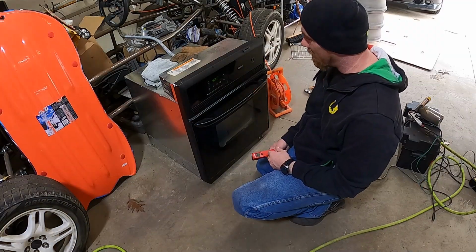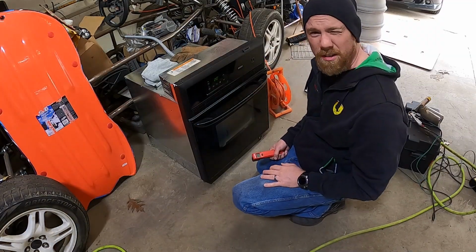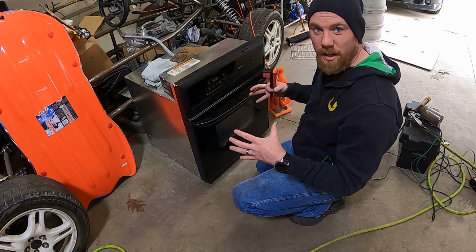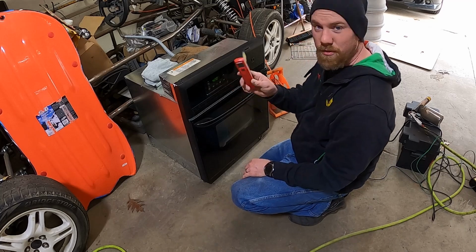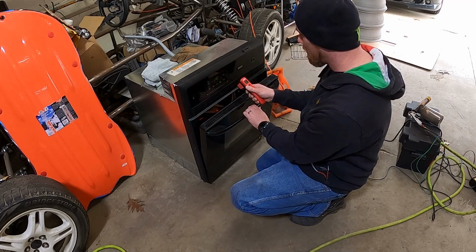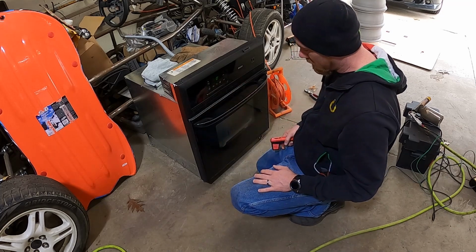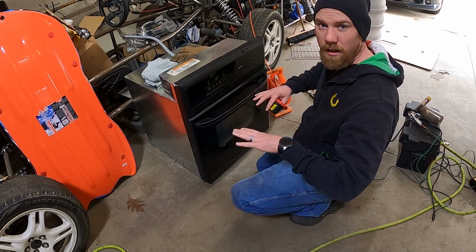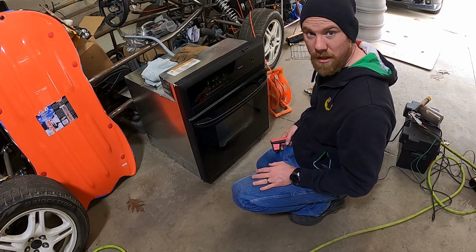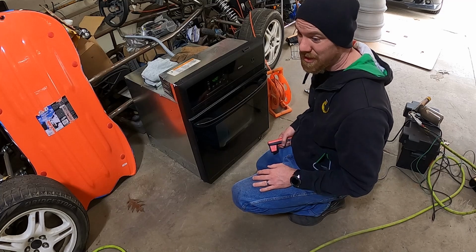All right, I got my oven set at 420 degrees. It says 400 degrees for 10 minutes. It's gonna take a little while for that rim to get hot. So I've got an infrared little laser thermometer, just to keep an eye on it. And we're up to 140 degrees. So once it hits 400, it'll start to lay out and get glossy. And then I will bake it for about 10 minutes at that temperature. See how it turns out.